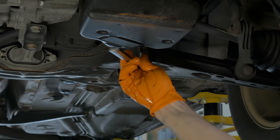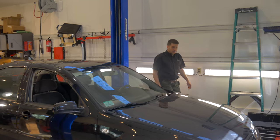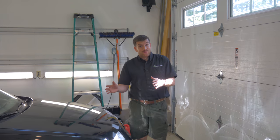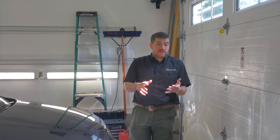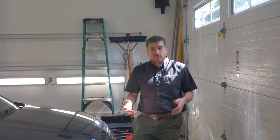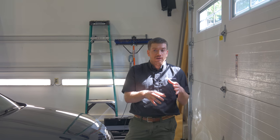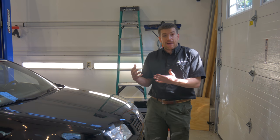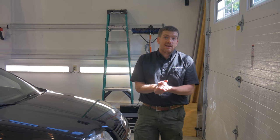Tighten it down — not too tight; it can torque back. We just got back from the test drive. We were hoping that the 1-2 shift, which was pretty bad before, would smooth out, and with the new fluid and filter it was much better. If you're going on a test drive, be sure you do wide open throttle, partial throttle, get it up to full highway speed, and come off stops — really try to get the transmission to go through all the gears to make sure your fluid level is right. If your fluid level isn't right, you'll get some delayed or hard shifting. Then get back under the car, put in some more fluid, let it drain out again, and try to get the level right a second time.